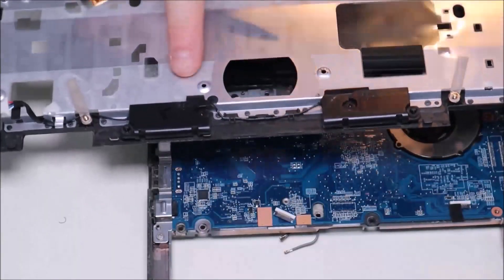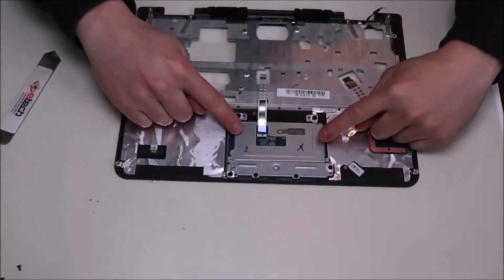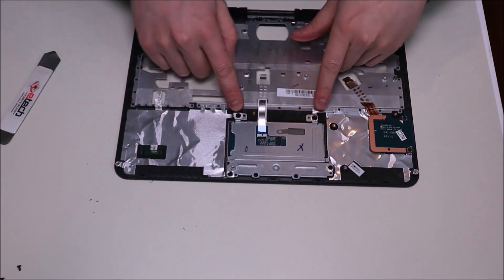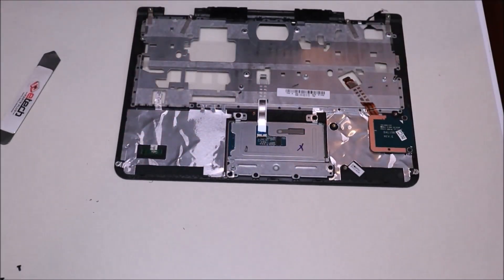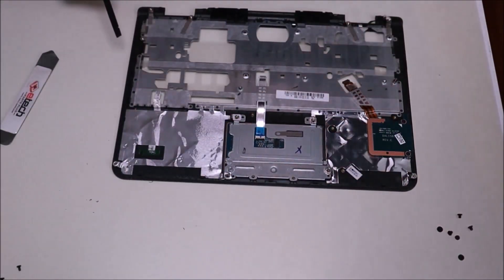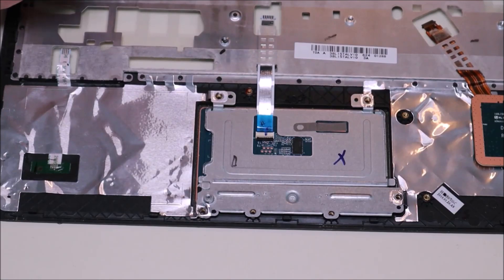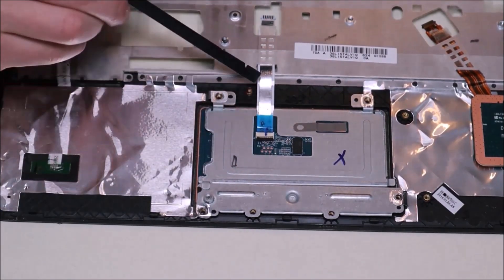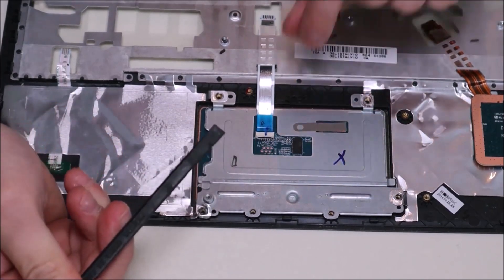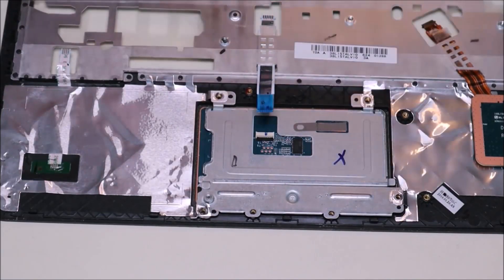There are your speakers — they come up with two screws, the wire runs there, and now that we've done that the palm rest is free. On the palm rest there's your touchpad assembly — you can see the ribbon cable going from it up to the motherboard. The touchpad assembly is held on by two screws here and four screws down there. Now that that's done I'm going to unplug the ribbon cable. The clip is on the reverse side from the ribbon cable, so instead of popping up the clip on this side, we put our pry tool on the other side, pop up that black clip, and the ribbon cable can be released.